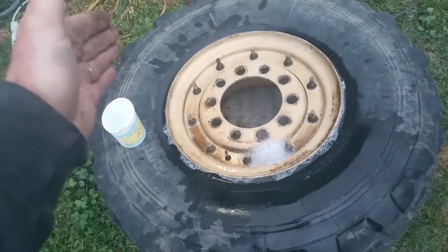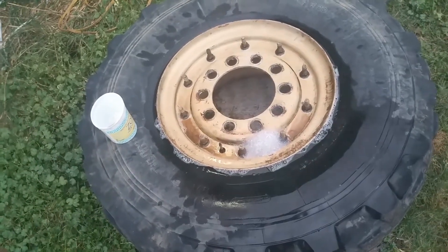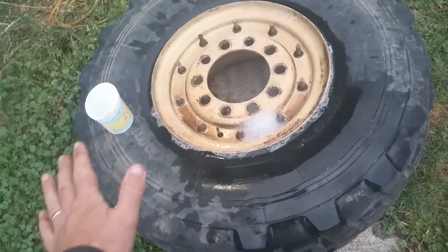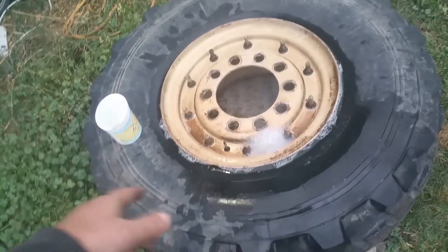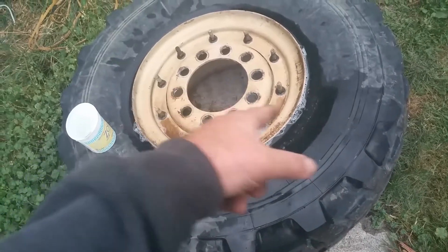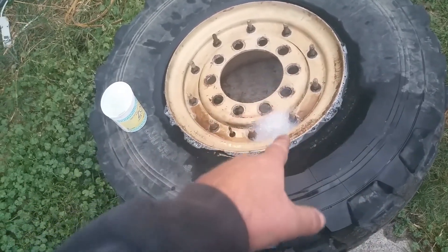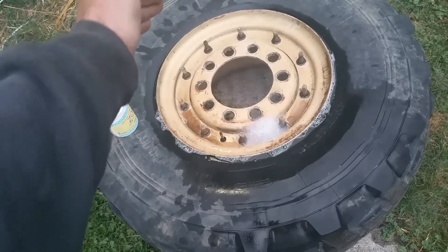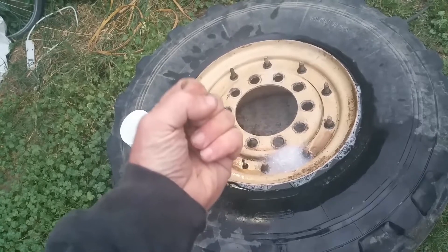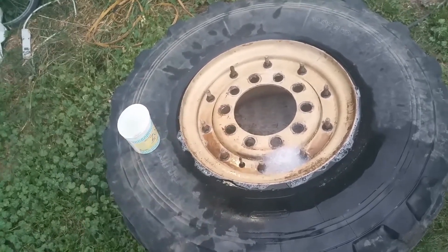If you suspect you've got leaking rings, what you need to do first is run the tires up to about 90 PSI — whatever the rims say, assuming you trust your tires, at your own risk. Not necessarily the tires, because I've found that the tires will sometimes have a higher PSI rating than the rims. Run them up to whatever the rims say and let it sit there for a bit. That might actually seat those O-rings tightly against the rim and solve all of your problems.